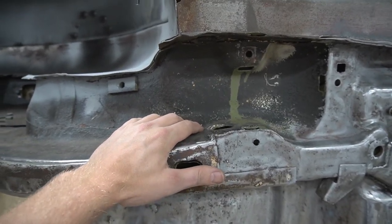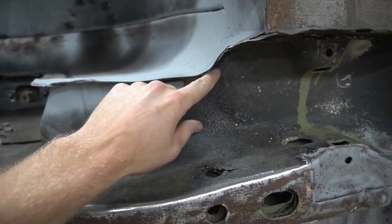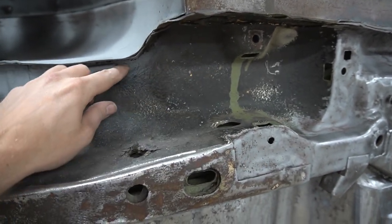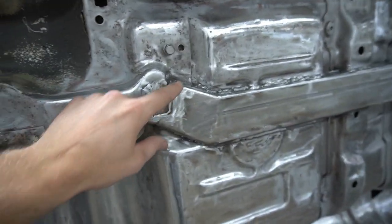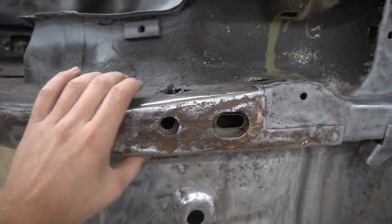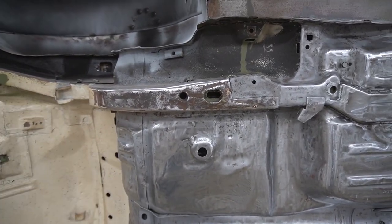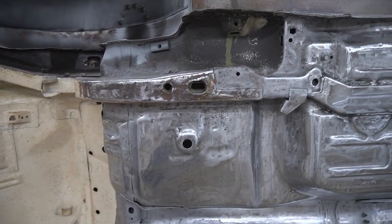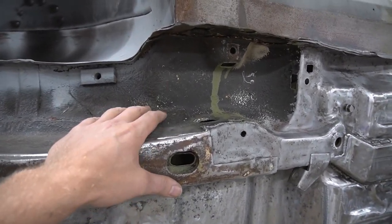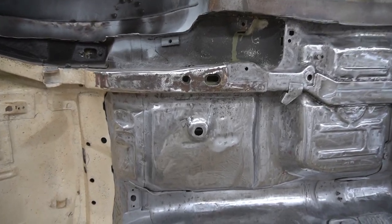The other reason I don't want to rip these torque boxes out is because I cut out these seatbelt pockets that were up here and I had to reshape and cut out a piece of this torque box. So getting a replacement, I'm going to have to do some work because I'll probably have to cut it to fit. And I doubt I'll be able to get all this out, so I'd have to make some kind of cut. Hopefully all this is good and we can just cut out this section and replace it. I'll put in some extra plates to make it nice and strong. But that's what we're tackling next time. I wish I would have seen this sooner — it would have been easier to probably drop the torque box and put a new one in before I welded my subframe connectors. But that's what happens with these projects — take a step forward and you get two back. No worries, we'll get it.